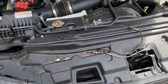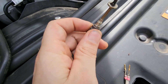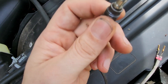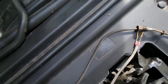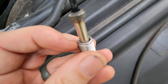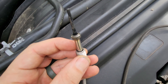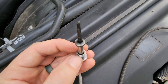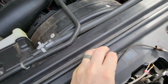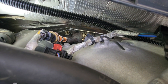I took the nut that was there — the stock ones are flat on the inside. I took a drill bit and made it kind of recessed, because the thermocouple probe that comes with the GlowShift kit has a copper ferrule — a crush ferrule — to seal it up. I wanted a better seal on it, so I tightened it down and it sealed up perfectly.